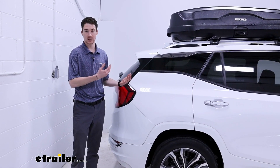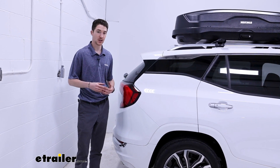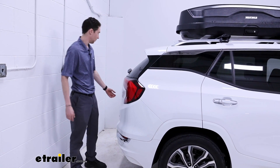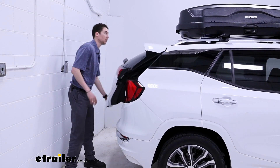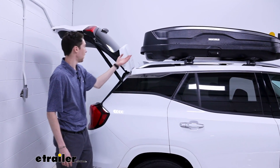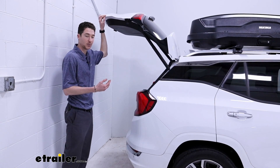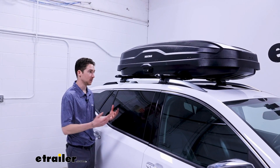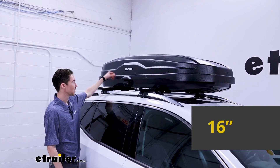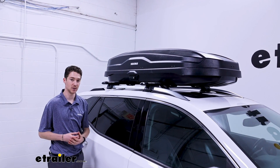Where you have your box could depend on where you set up your roof rack system. On this vehicle we have raised rails, so we do have the ability to adjust it a little bit. As we have it now it's pretty much in the middle and we still have hatch access — the Skybox NX16 has that undercut tail in the back so it doesn't take up a ton of space, and we have plenty of room before making contact with the hatch. Keep in mind this system adds about 16 inches of height to the highest point from the top of our rails, so that's the number to consider for garage clearance or anywhere you might run into clearance issues.